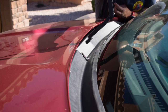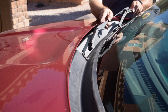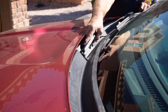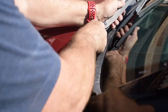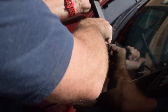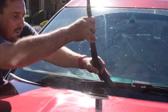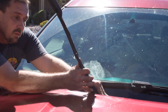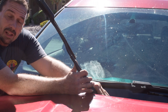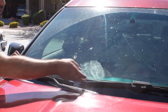Now we put the windshield wipers back on. I recommend flattening out your windshield wiper and getting it into place where you need it. Then if you open it up it allows it to sit into the grooves that exist in the post. I had to take this one back off because it wasn't aligned right — it would wipe the windshield just fine, but I didn't like where it sat. I want it to sit across this black line, similar to the other side.